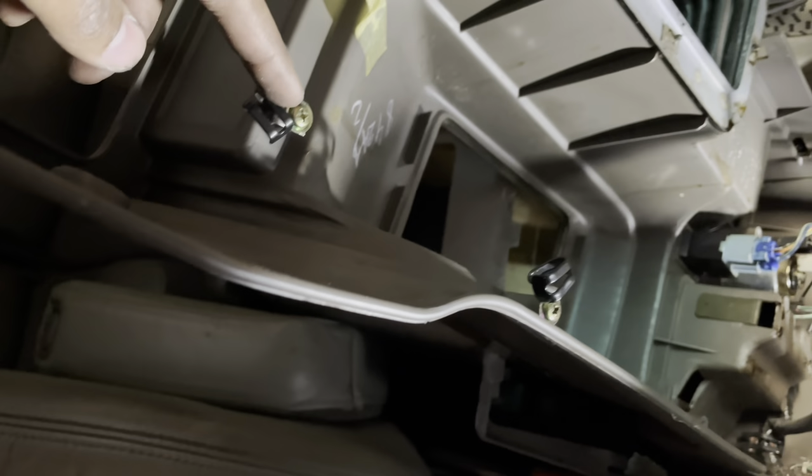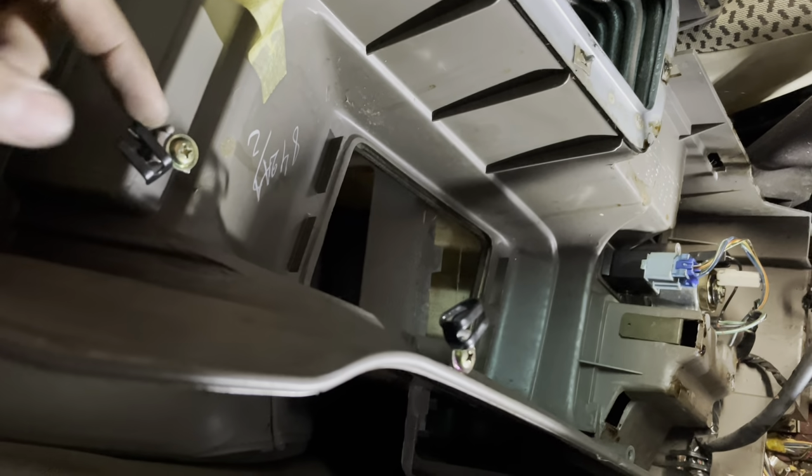and one of them is still attached. There's three clips that you gotta undo. So one over here, one over here. This one's pretty much easy, but this one's a hard one, because if yours is that close to it, it's gonna be hard. So all you do is, there's like a little hook right there. You just pull it open. The wire goes in through here, so you pretty much want to slide it out and then just push it up so it kind of pops out.